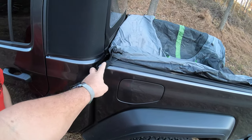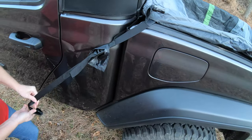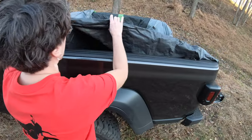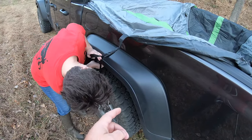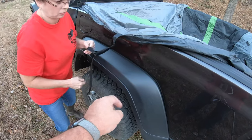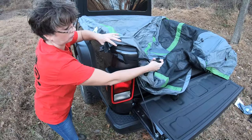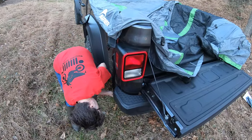This strap here on the front corner has a kind of a Y on it, so we'll spread it and run it down and hook it under the bottom of the cab right there. The second strap we'll hook underneath the fender, or if we can find a place on the metal we could do it there — that'll work for now. Then our third strap we'll hook it under the back side right here.